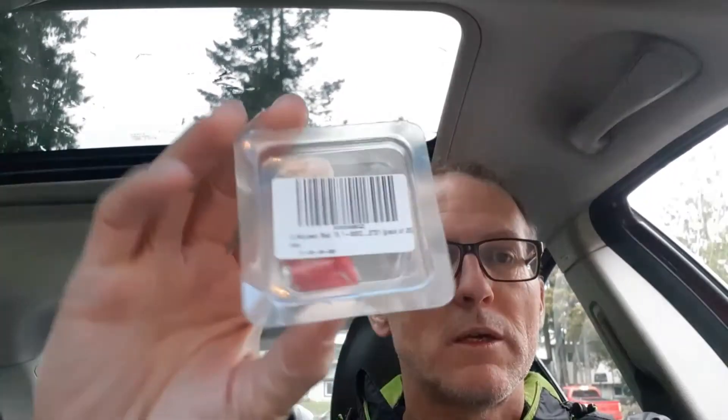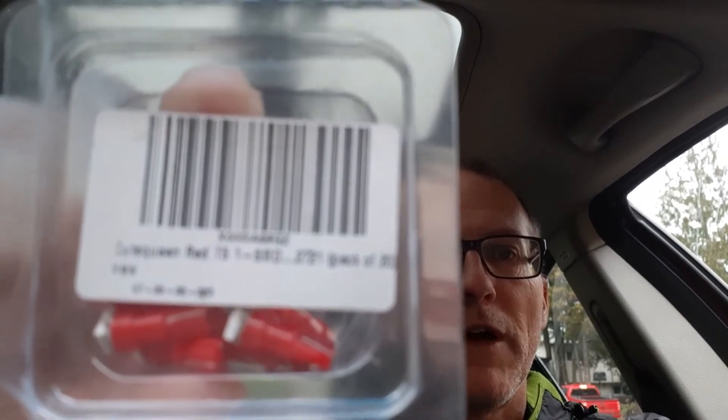What I decided to do was disregard what the dealer said — because I know their job is to gouge you for as much money as they can — and investigate it myself to see if I could figure out the problem. One of the key problems is gauge clusters with bulbs out. So the first thing I did was remove the gauge cluster — which I'm going to show you how to do — and check the bulbs. Sure enough, I found one of the bulbs was out. Fortunately I had a 20-pack of bulbs. I got this one off Amazon — it's made by a company called Cute Queen, a T5 SMD 2721 — a pack of 20, and I don't think I paid more than $10 including shipping.